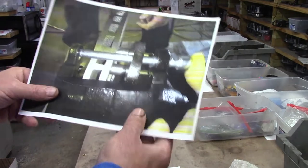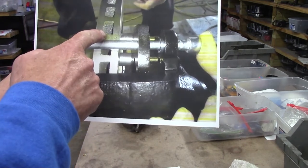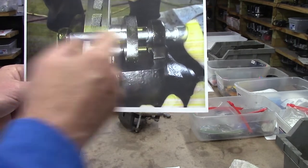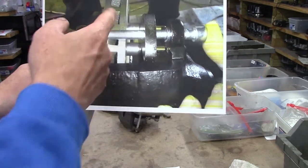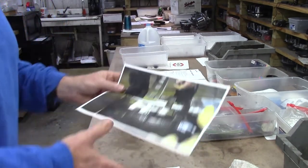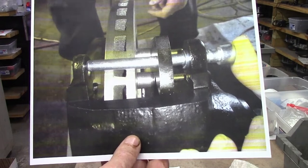The customer's installing his kit and he's talking about how things won't line up. We do a lot of different Mopar axles — it's the only ones we do. I can tell from looking at the picture that he's got the shaved rotors. I don't know who this gentleman is or what car it is, but I can figure out a couple of things. That picture right there tells me that's a shaved rotor, so it's not a normal 15-inch kit — it is a 14-inch kit. In that 14-inch kit there are two different rotor sizes depending on the axle.